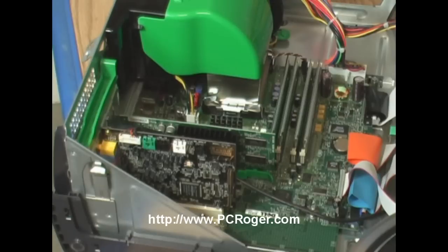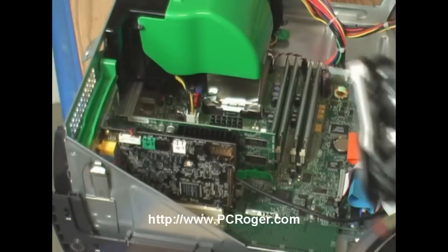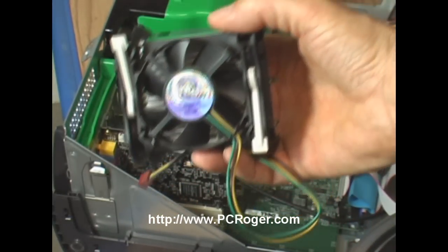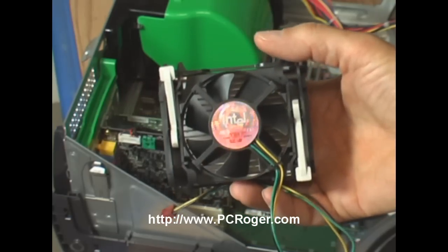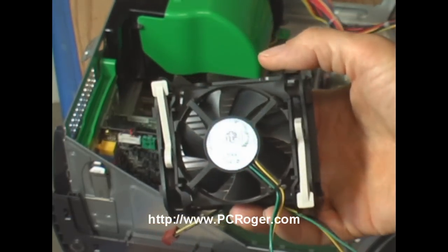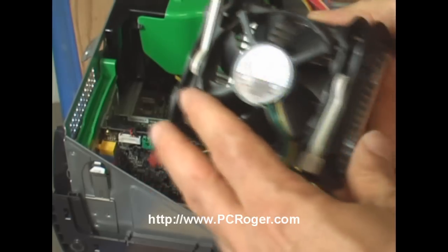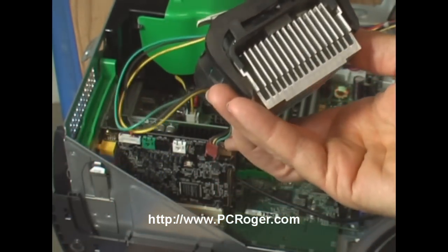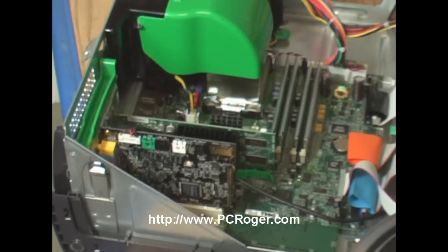One of the things you will not see on a Dell or certain big-name computers is the standard CPU with a fan. If you build your own PC or have a custom-built PC, you'll probably see something like this. The fan blades will collect a lot of dirt and lint — you'll want to get those cleaned off. These cooling fins, you want to make sure there's not dirt packed in there, which is oftentimes the case.